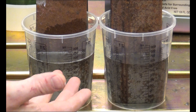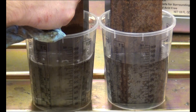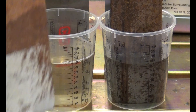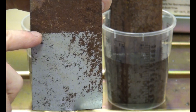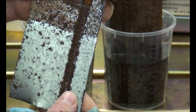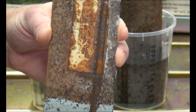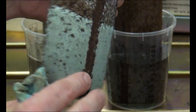It's been 30 minutes and I'm going to take the metal out of the solutions, wipe it down, and see what everything looks like. Starting with Rust Release — I'm going to wipe it off front and back. There was a fair amount of pitting on this part. You can see the line where it was soaking in the solution. Wherever it was pitted, it turned black, so it neutralized that rust. On the back side, there is still some rust — some of it's black, some is still rusted and would need to soak a little bit more. This piece was fairly heavily rusted. But overall, it looks like it did a pretty nice job in about 30 minutes.